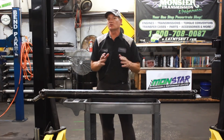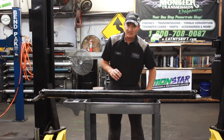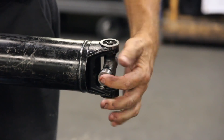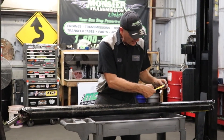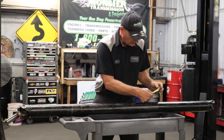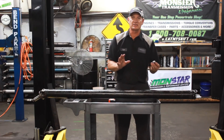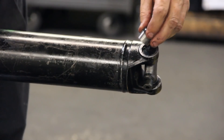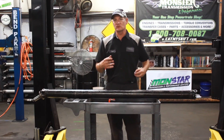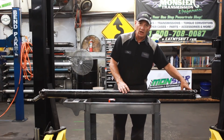Then we need to know more details like actually what size U-joint you're using. You actually have to take one of the caps off. There's a cap off the rear — this fits into the differential. You measure the actual size of the cap itself. So there's a one-inch cap, and then verify your other U-joints are the same size. You can simply place it and see if it fits in, because sometimes we have a driveshaft that has two different size joints on either end.